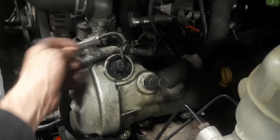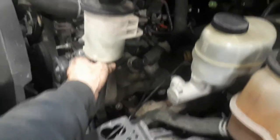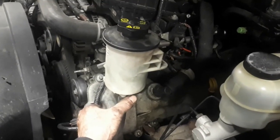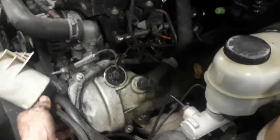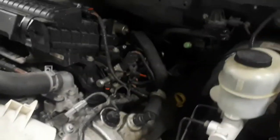So going over the driver's side hardware: the power steering pump reservoir sits up above on a big metal bracket that bolts down below the valve cover - it's a painful 18mm bolt, big long one. Then another bracket on the front with some 13mm bolts. And last but not least, three 7mm bolts that hold the reservoir to the bracket. After having popped my PCV line back on - they're just little quick-release fittings, you pull the little tab and pop the thing up, they're quite great, I've never seen them until this Ford.